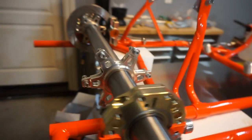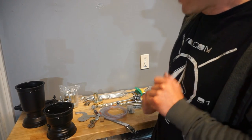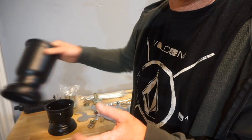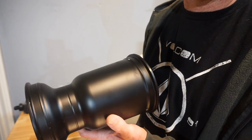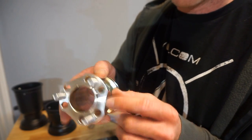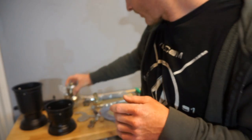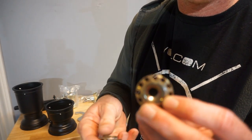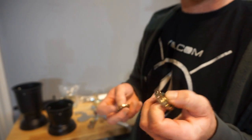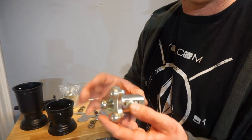I'll show you the components it comes with from the factory for the Intrepid FK4. Here are the magnesium wheels — a lower volume type, and you can choose either six-inch or seven-inch rear depending on what you want. They're a 90mm rear hub with that zinc plating and drilled for lightness and airflow toward the wheel where it mounts. Here are the camber/caster adjusters it comes with — the top one and the bottom one. A lot of times for four-strokes we'll use just the top and neutral; if it's raining or we really want to take some front grip out, we'll use the bottom as well.